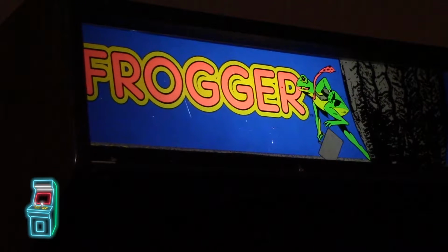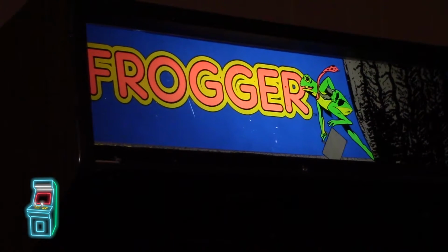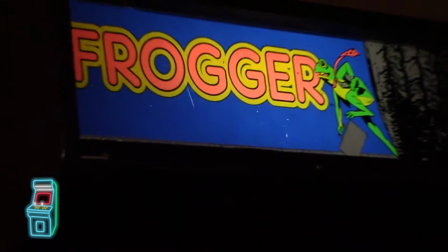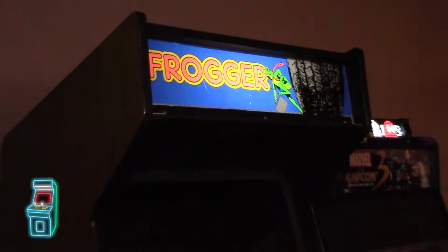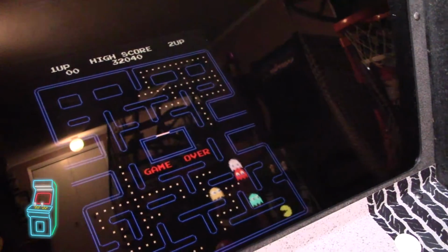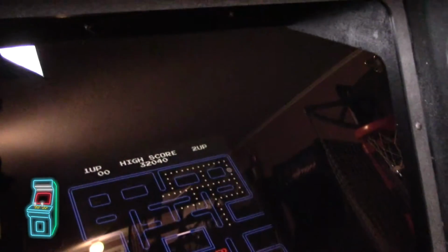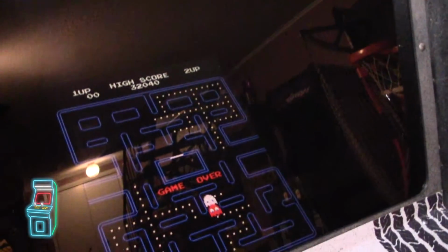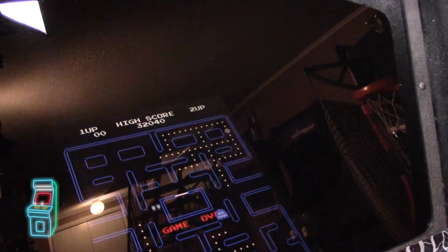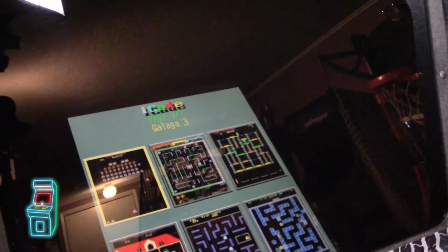So I actually replaced that with a cheap $10 cold cathode 12-volt tube, and it looks really good. I mean, it's not the perfect marquee there, but it does the job, lights it up. I made a whole bezel in there, created it from scratch. The light was bleeding in there as well, so I patched that up. I put some cardboard in there that's really durable.